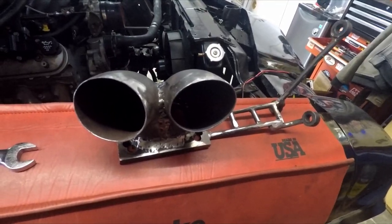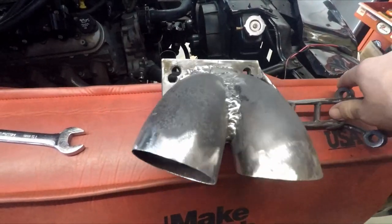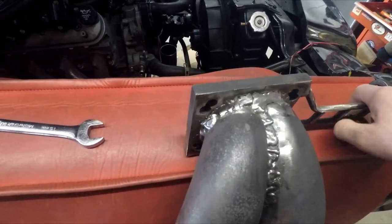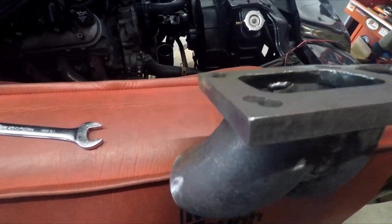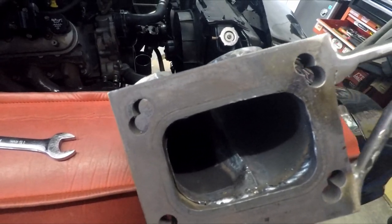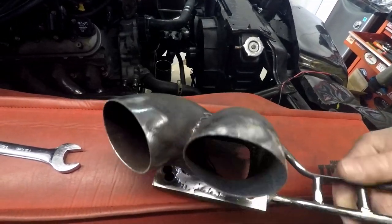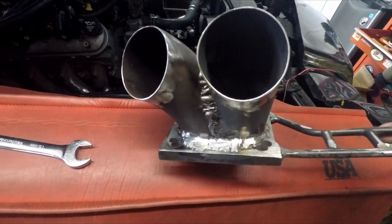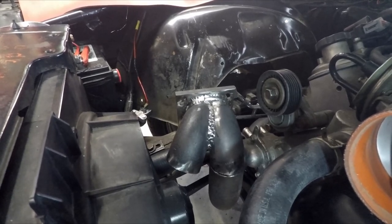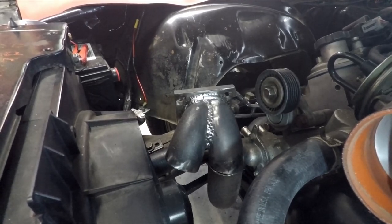After a lot of — let's say — butchery, here's my turbo merge. Definitely horrible welds, I apologize. Still trying to figure it out — probably too much wire. Inside it's kind of upside down; I'll dress the inside with a flap wheel on my die grinder. But that is essentially what it's going to look like. Let's see how it fits on the car — it's bolted up, so I'll tack that passenger side now and then we can pull it all off and do the final weld.